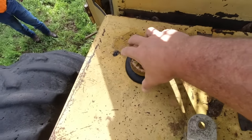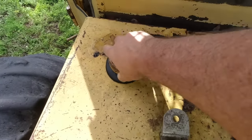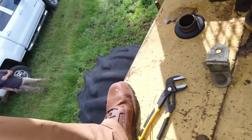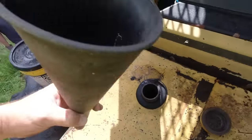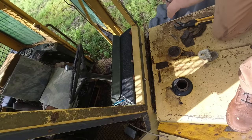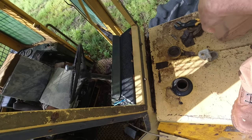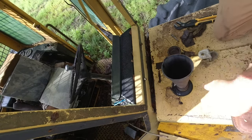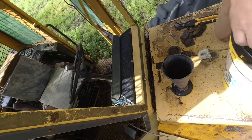Both batteries are reading 13.5 volts, so we should be good. I got this little thing off Amazon — it was like 10 bucks — but for a simple quick reading on volts or amps, this thing has been the bee's knees. Jacob, how about switching the key on? The pump is switching on — you hear it clicking over here when Jacob does stuff. So we know we've got some fire. Let's go over to the starter and see.